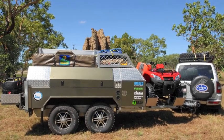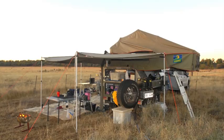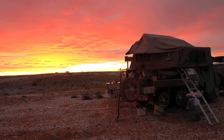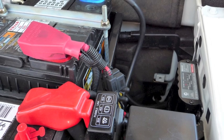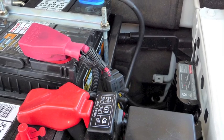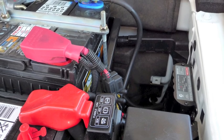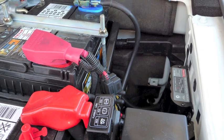But on the shakedown trip I did, I got to Darwin and I boiled a battery. I'm not a very good auto electrician or mechanic for that matter, but what was happening is that the alternator regulator senses that there's a flat battery somewhere, namely the ones in the trailer, so it opens up the gate and gives it full charge right the way through. Of course the first battery it gets to, the full charge goes into the cranking battery and I was boiling the battery.